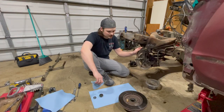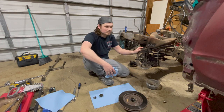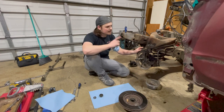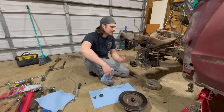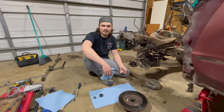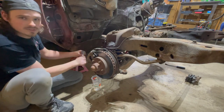So now that we have our brake rotor off and our bearings out, we have our spindle exposed. We'll go ahead and get this backing plate removed, and then once that's out of the way we'll get the sway bar out of the way, then start separating the control arms from the knuckle and start pulling our spring and shock out, then get our control arms off. Same deal with this side - we're just going to get the caliper off and get the rotor off.